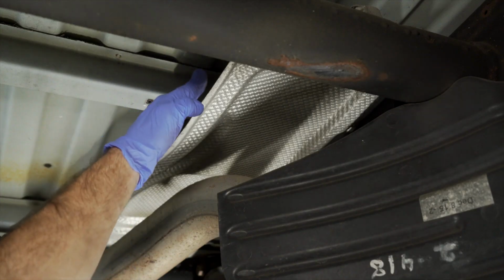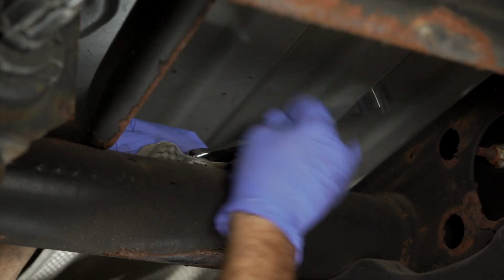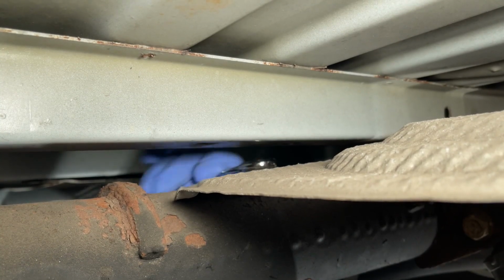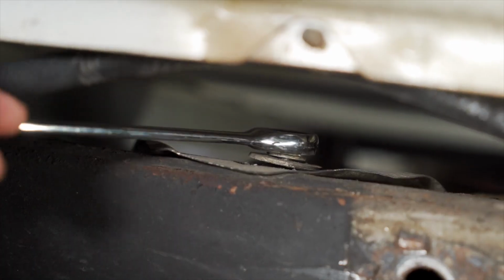We can now alter or remove our heat shield. For a 2015 and older, you will follow the instructions to alter. Our customer has the 2016 or newer. Use a 13mm wrench or ratcheting wrench to remove the fasteners. 2 fasteners will be underneath inside of the cross members. 2 will be accessed from above the passenger side rear tire.